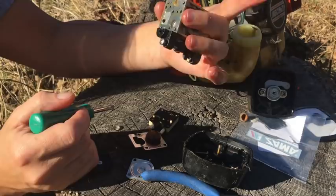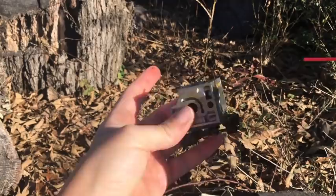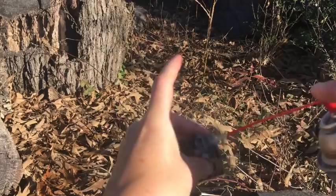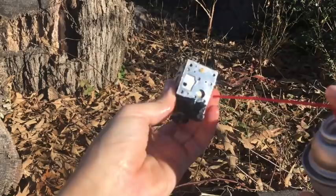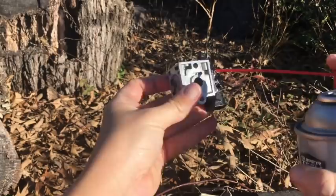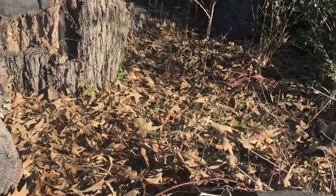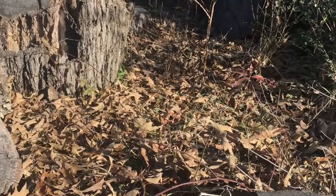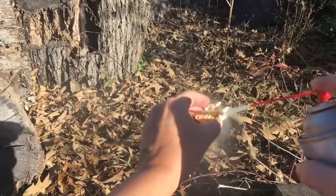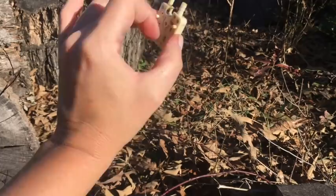Now it's apart and it needs to be cleaned. To clean out your carburetor, first give it an overall spray everywhere. Wear your safety goggles so you aren't sprayed in the face. We want to make sure we go through our needle hole — it's best to hold it in this position so nothing sprays at you. Next, get the diaphragms off of the block and give it a good once over. You never ever want to blow compressed air into these — they have little tiny diaphragms inside that you will destroy.